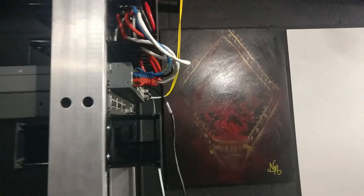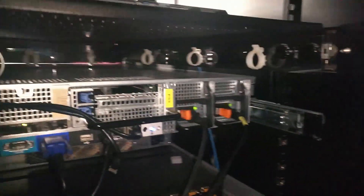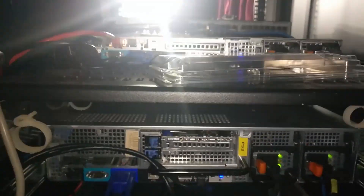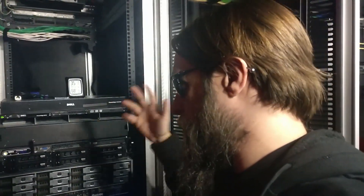Some people are asking what this is all for — I have a background in network engineering and system architecture. I'm upgrading my switch and my network to 10 gig. One of these is running to my desktop and the other is running to my virtual machine server. When my multi-mode cables come in — it's Christmas time so they're delayed — I'm going to plug in two receivers, run them up and over to this server, and plug in this card. It's a Mellanox card going into the firewall. The firewall will have a 10 gig uplink to the internal network, which will allow me to carve off VLANs and handle any kind of interconnection between VLANs with plenty of bandwidth.